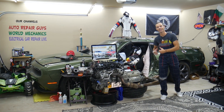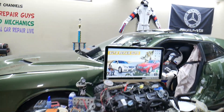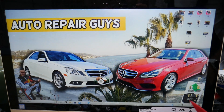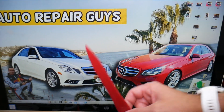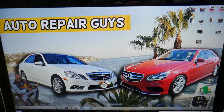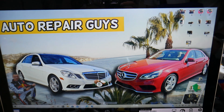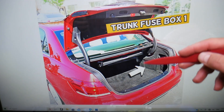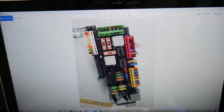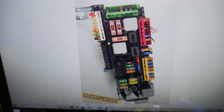Let's go ahead and explain where you can expect to find the seat belt pretensioner fuses. This is the pre-facelifted model; this one has the facelift — both are the same W212 generation. You have multiple fuse boxes, but today we're working in the one in the trunk. Open the trunk, go to the right side, open the cover, and underneath you'll find a fuse box with a layout that looks just like this one right here.